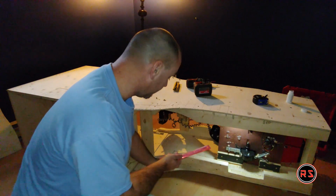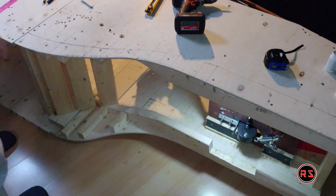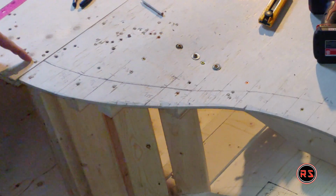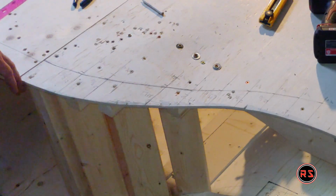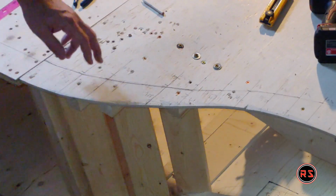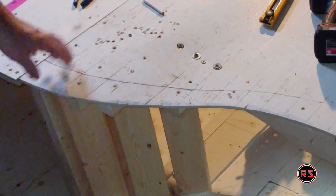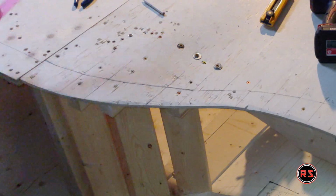And I will completely remove it and I will cut the side panel on both sides, but let me show you. If you look here, you will see straight away that there's a gap here, and my 3 inches here is not lining up with that line, which is also 3 inches. The reason is that I don't have a floor underneath this section, but here I obviously have the floor with that curve. And this gap is for the thickness of the plywood that I'm using for the floor, which is 3/8 of an inch. It's the same size of plywood as this one. And when the floor is installed, it will be flush, so it will be even.